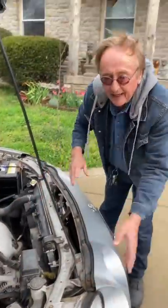And lastly, check the fan belt, or drive belt. If it's loose, it won't charge right. And of course, make sure it's there. I've fixed many cars by telling customers, well your fan belt was old and it just flew off — all you need is a fan belt.